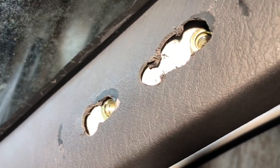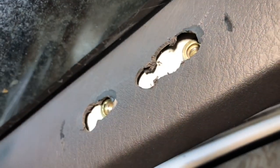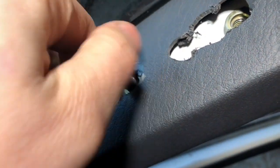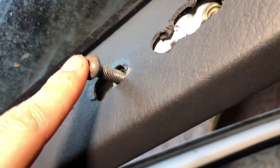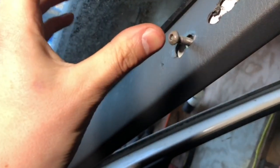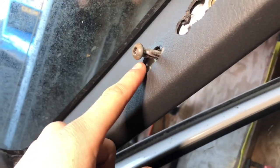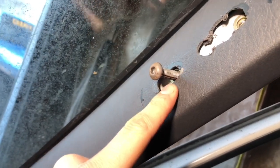What I would recommend doing is, once you get the nutserts installed, thread the bolts in a little bit. Then put a dab of grease on the end of the bolt, get your plastic panel, get it all aligned, press it against the bolts and pull it off. You'll have a little grease blob showing exactly where you need to drill. I didn't do that — you can do it my way and kind of hunt and search, but I had to oval out these holes quite a bit to make it fit.